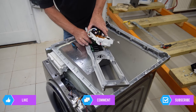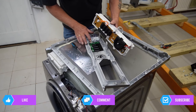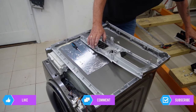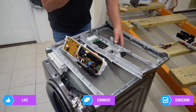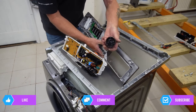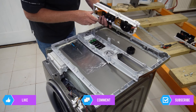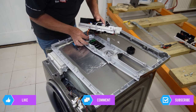Once you've got them released, you can lift the circuit board out. You'll find another wire that connects to the control panel on the front. Put the old circuit board to one side. Now I'm taking the knob off the control panel so I can relocate it after, and I'll insert the new wire.